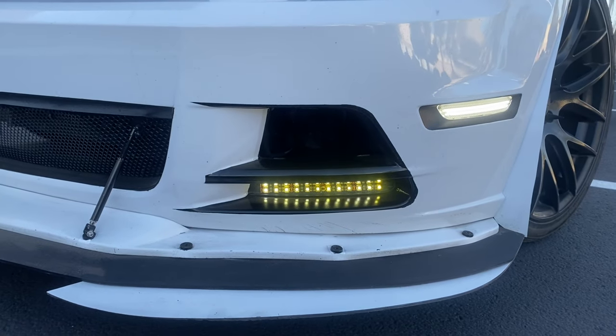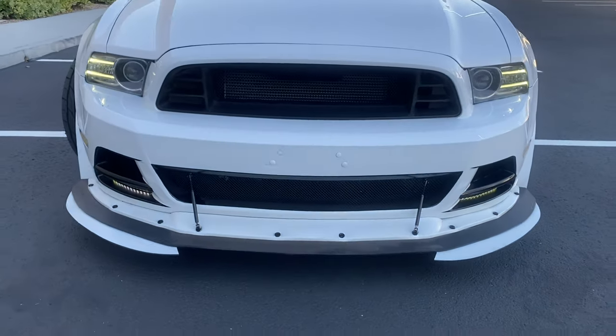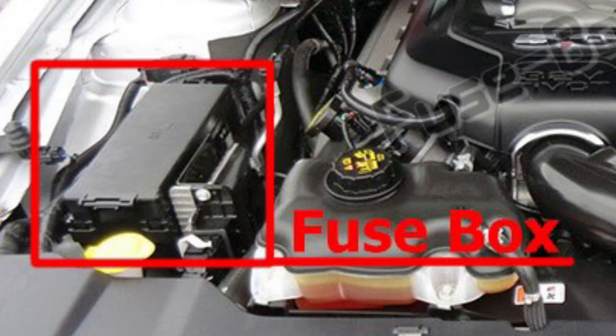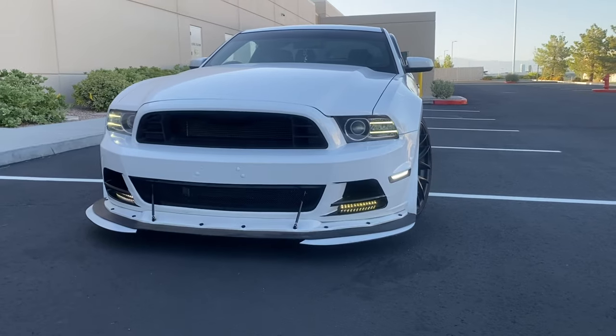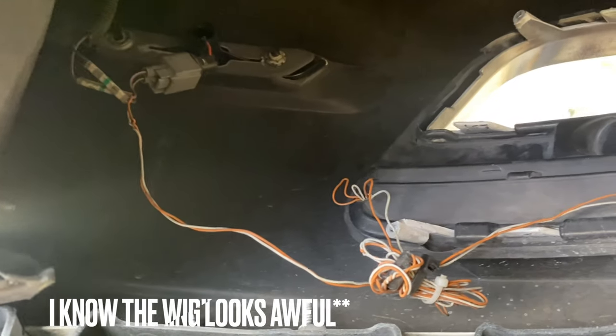There are a variety of places you can hook this up. I ended up hooking mine to my side marker lights, so every time I turn on my headlight switch the fog lights turn on as well. You can also hook it up to an independent switch going straight to the battery, or to an empty fuse inside the fuse box. Personally, I found it easiest to tap into the side marker because it's directly next to the fog lights — just tapping into the positive and negative on the side marker light.